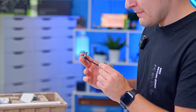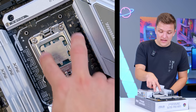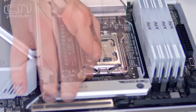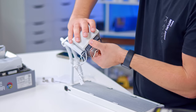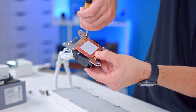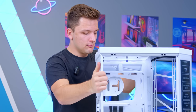Inside the box, you get what looks to be an Intel bracket, but this is an AMD build so we won't need that. What we need are the AMD-specific screws — you want to remove the plastic brackets from the screw threads and add in the AMD-specific screws instead. I'm also going to pop on the AMD brackets, which go onto the bottom of the cooler. I'll take the top plate off to make fastening things to the cooler far, far easier before moving this into the case for the motherboard assembly installation.